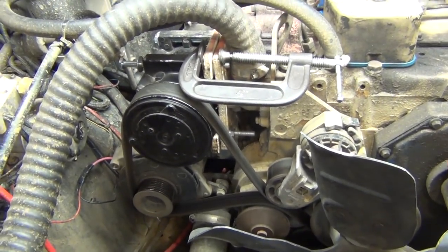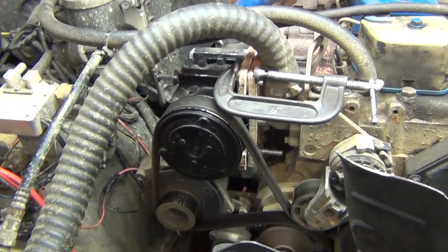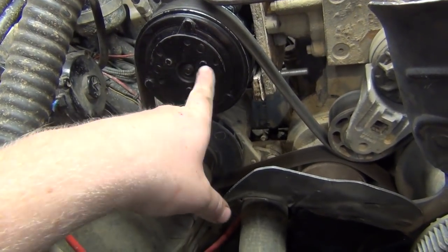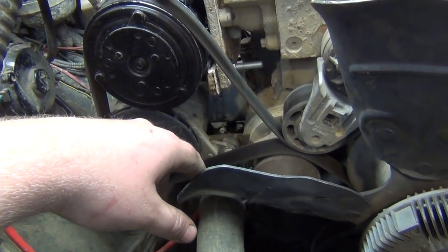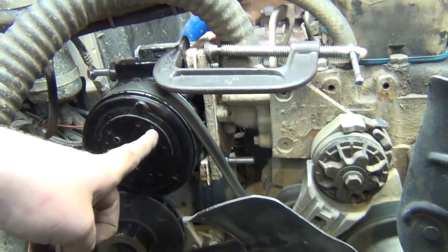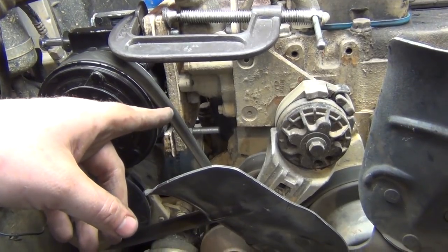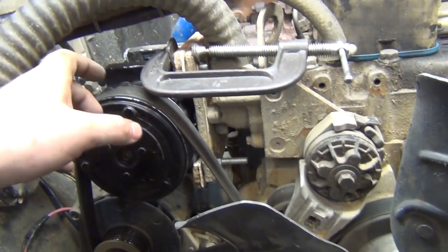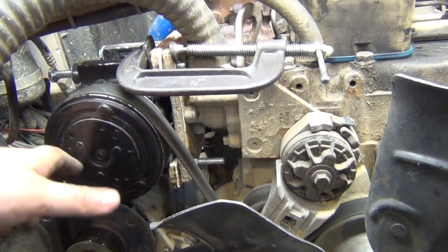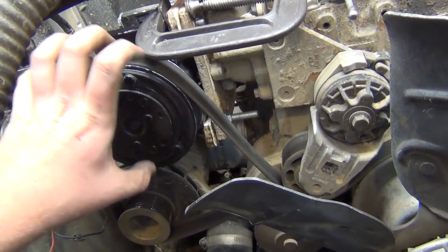Well, tubers, I think we're gonna call that a night. For right now, the wood template is giving me an idea of where this is gonna sit and how it needs to align, but because it's wood, it's not very accurate. So this thing is actually wanting to pull that way just because of how it's bolted down. For the most part, I got the height set up, and I figure when I make my actual bracket to bolt on here, I'm gonna leave one bolt hole the same size as the bolt, so it'll be close enough to precise, it'll be spot on. And then leaving the rest of the bolt holes sloppy will give me up and down adjustments so I can fine tune it.